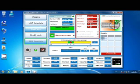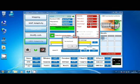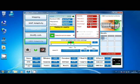Well, you see here a green button. By clicking here, no error found. So green means that there is no latent error at all. Okay, so you don't see anything. Well, we are monitoring the situation. The gas ECU is asking the petrol ECU if some latent error is there, but there isn't.